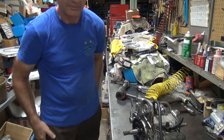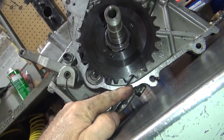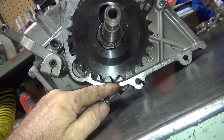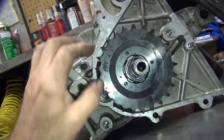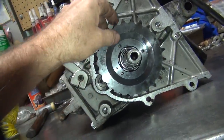See how close it is down there? So what's down there — rubber or metal? It's going to be a problem. When the top of the teeth are rubbing on the inside of your thing there, that means you can't go this big. It's going to be a problem — yes, it's too big. So if you lose the chain oiler, you can run a big sprocket. If you're going to run a stock oiling system, then you're going to have to not go that big.